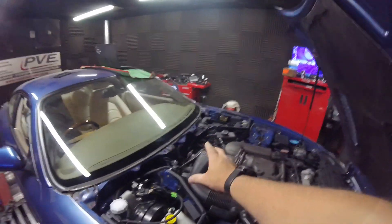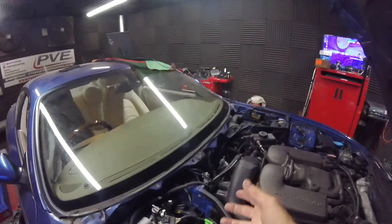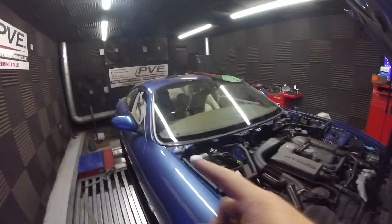The benefit of this is it doesn't really care what gearbox you put in there, as long as you have the CAN structure so you can program it. Same with the engine — you could put whatever you want in there and have all the instruments working as they should. We've got traction control working and we can see all the wheel speed data.